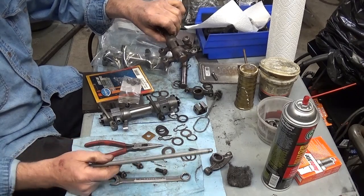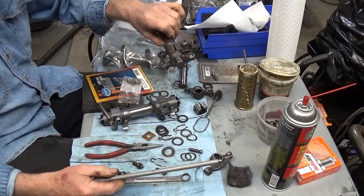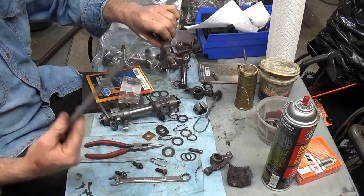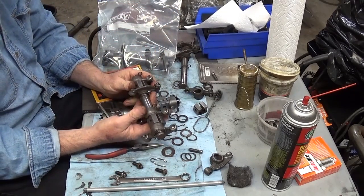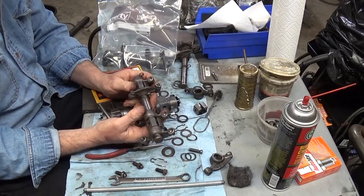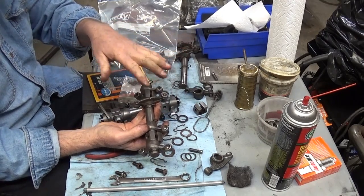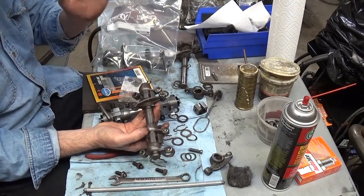It doesn't make any difference at an idle or to like 3,000-4,000 RPM. You're pushing it at even 4,000 RPM. You'll get valve float, and what valve float is, it's moving too fast, and your spring works for a while. It'll work awesome. You take off down the block and you'll say, yeah, this is great. But it's beating your valves.